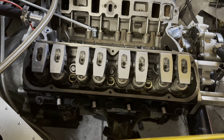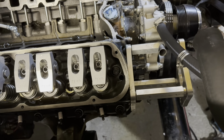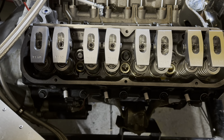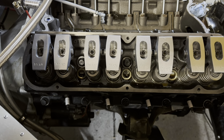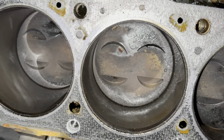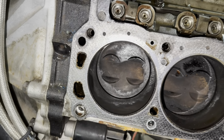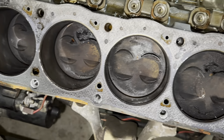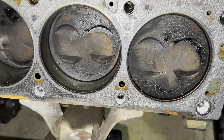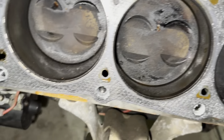On the passenger side, double checked — made sure there's nothing attached to the block anywhere that's going to cause an issue. That bracket will all come off with the head right there. So I'm going to get these 10 bolts loosened, doing the reverse of the torquing sequence — starting with the outside working in. Well, 10 bolts later and the head is off. Looking down the cylinders — don't look too bad. There are some marks, but that's from me dropping the push rod when I was trying to take the head off. Those iron heads are not light to say the least.